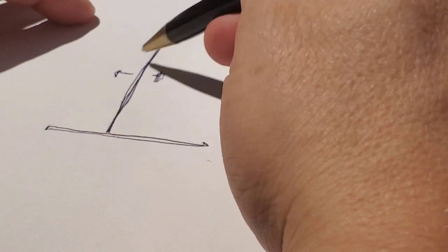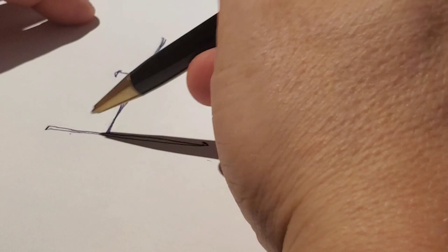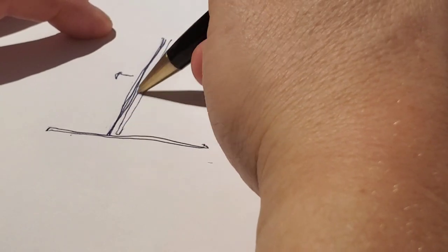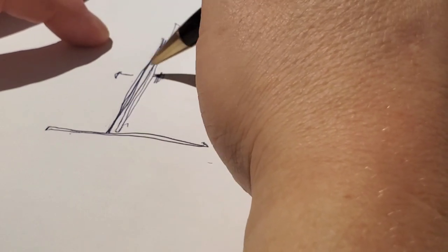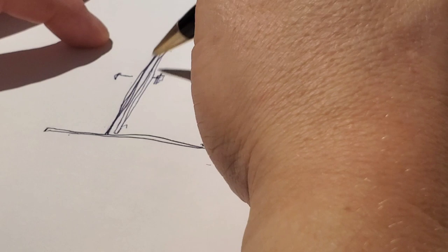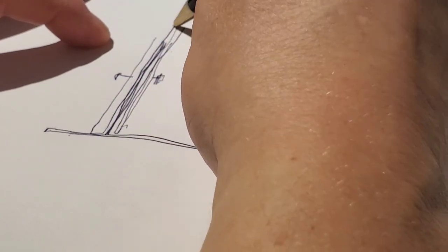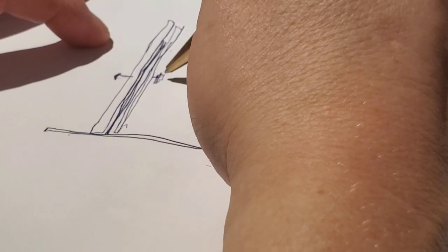You put the Maggie in front of this strut, okay? So it's behind and you don't see it. All you see is this little part. And here the Maggie is going to go right like that. Wait, I just did that wrong. The Maggie's going to be over here in front of the strut, like I said. And then you're going to put the carriage head through there, through the strut leg, and squeeze it down.